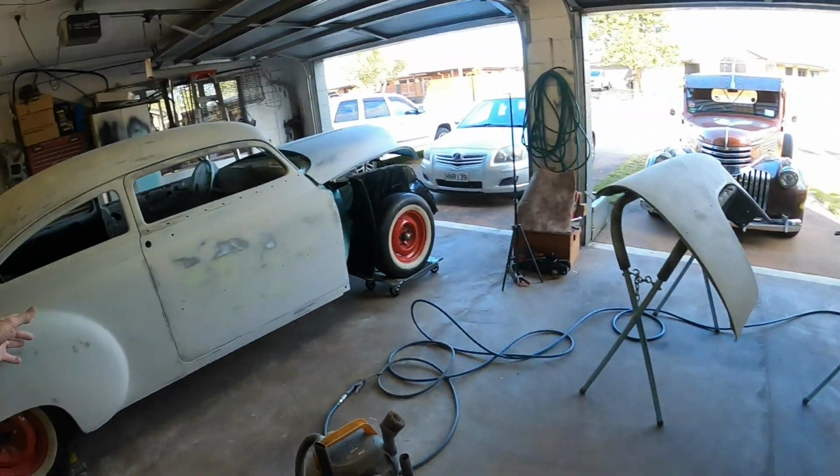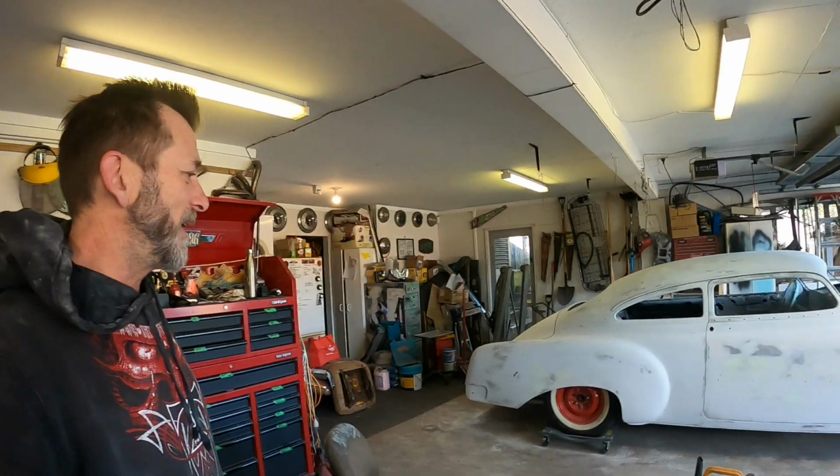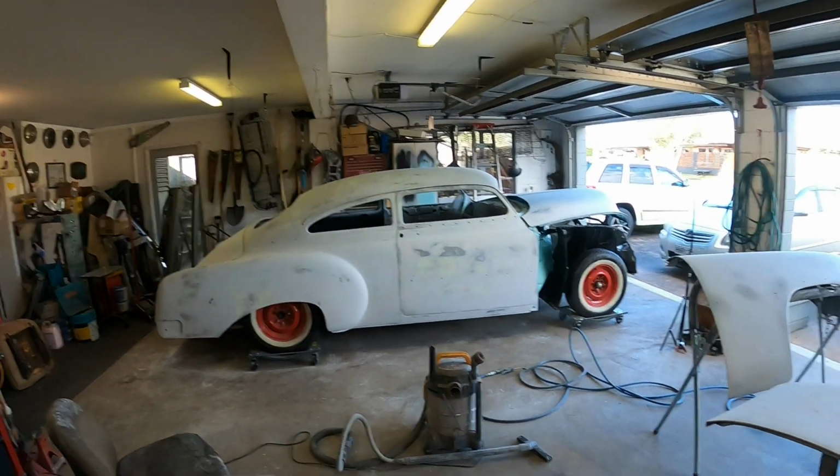Hey guys, well, that's it, all rubbed back, including the fender skirts and the fuel flap cover thingy bob over there, into 320. Something I learned from this is that when you think you've got things smoothed out and scratches flushed out and stuff like that, you haven't. I found so many scratches and pits and sanding scratches going over it again. It's just not funny. Oh, a little bit funny, but on the whole it's flushed out quite nicely.